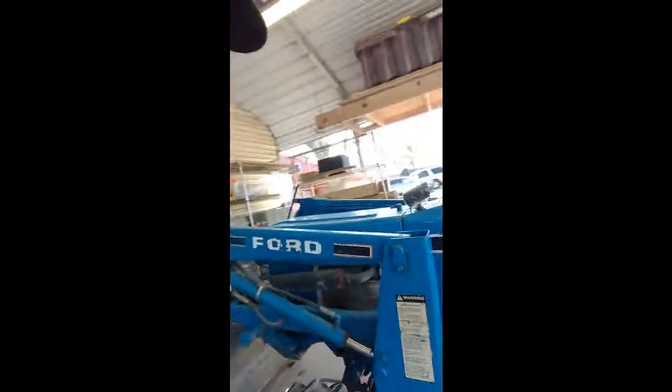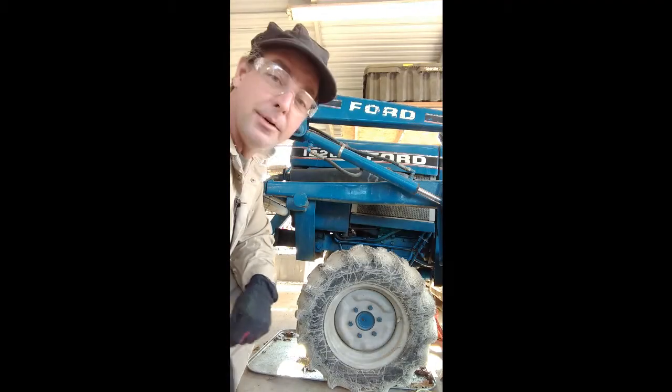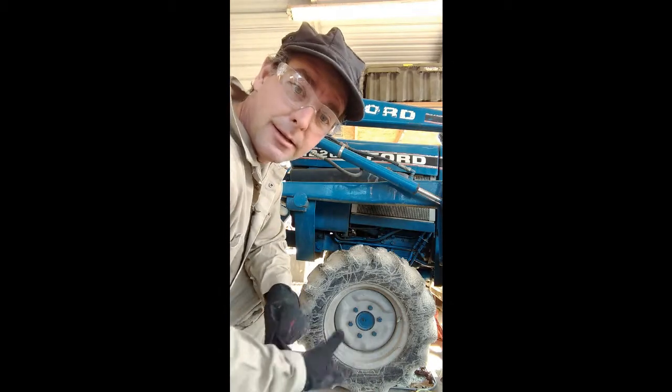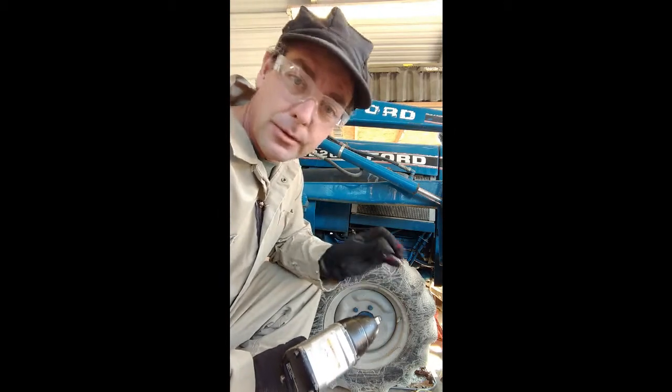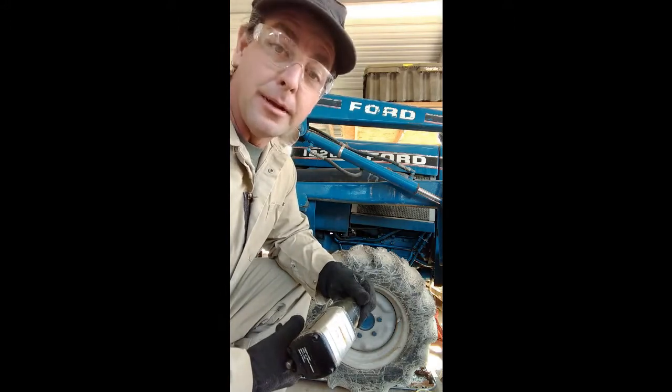What we're going to do here is remove the tires, steering linkage, drive shaft, all that stuff — there are a few other bolts to hold it in. The wheel comes off in a pretty simple operation. The main thing I wanted to show you: I've got safety glasses on, wearing gloves, using impact sockets. Don't use the chrome ones — they're going to bust at some point and you don't want to be there when it happens.